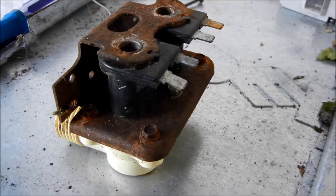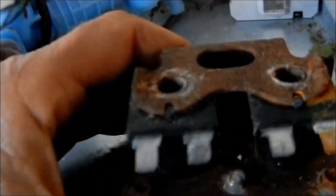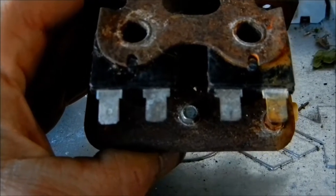So here's your washer valve. Here's actually another one — this one's got several valves on it. You can see these are all electromagnetic valves; they all have the loop inside. They should show continuity. If they don't, you've got a bad one. But this is your typical washing machine double valve, hot and cold. Basically we got a loop and we're checking for continuity.